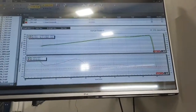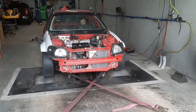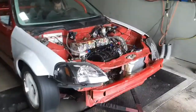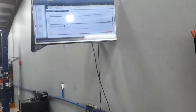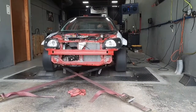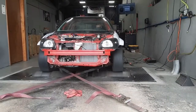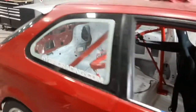We're a little rich in the beginning — it looks like 181. It starts to lean out on the top end. 192. What was that one? 192.